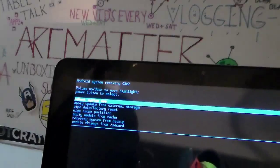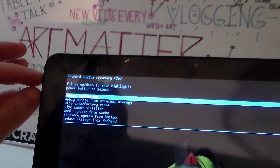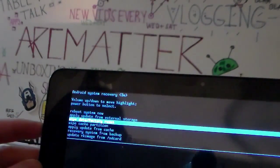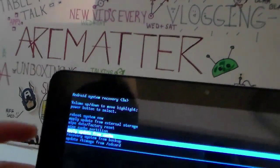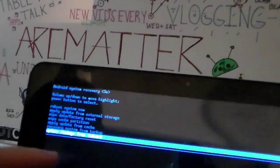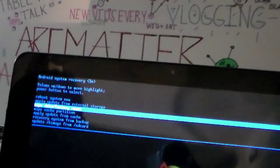Normally you can hit power, up, and down toggle and you'll go into recovery. When you see that red triangle with the Android — the red triangle of death is what I call it because the Android looks dead — on this one it was power and hold the toggle up. Now you can pick options: apply updates, wipe data, factory reset, or wipe cache partition. If you're having trouble with your tablet, wiping the cache partition will really help. It can make it come back, and if you've got a custom ROM you can apply updates from the cache or update the recovery image from the SD card.